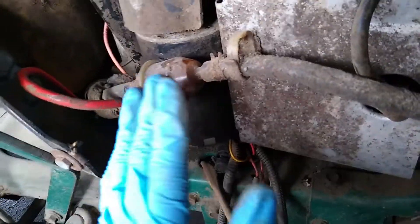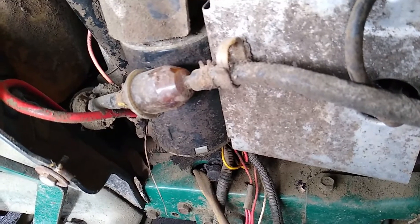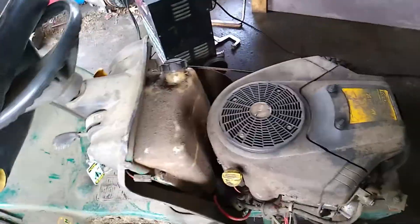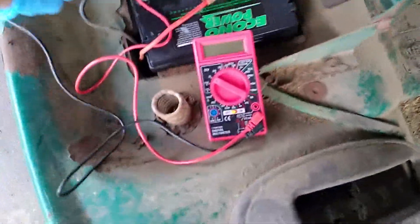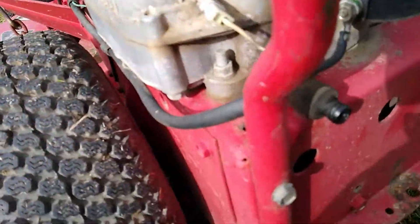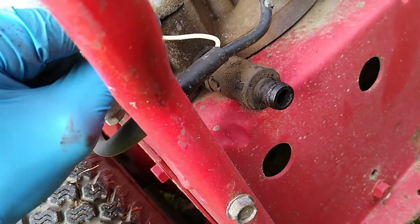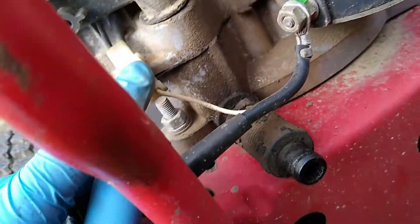I'm not going to show how to check the alternator on this one because someone's cobbled with the wires. But notice how fast the motor spun over — the battery voltage dropped to about 11.75, which is totally normal, then went right back up. That's because when the motor is spinning, there's an alternator under there with magnets on it. So we're going to go over to another mower — a Snapper — to start it up and check the alternator on it. On this one, you have two wires coming out of the top: one is the alternator wire and the other is the engine stop wire.